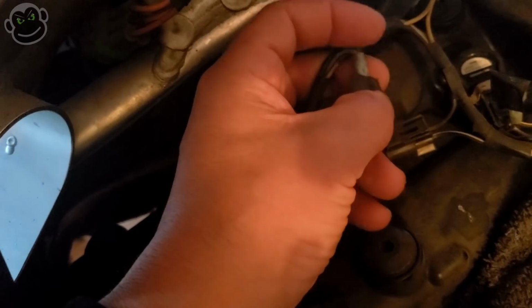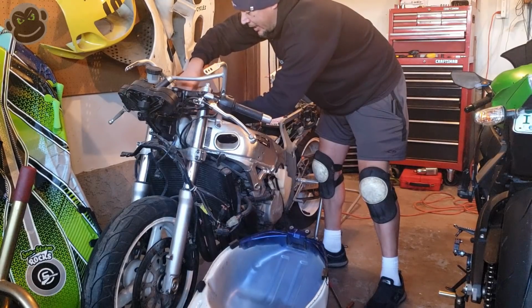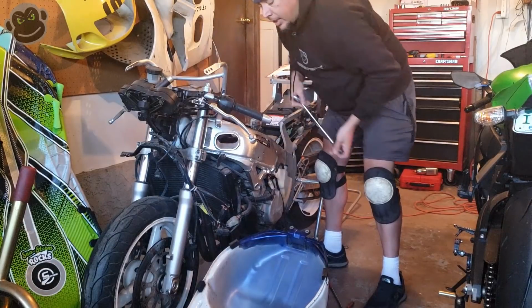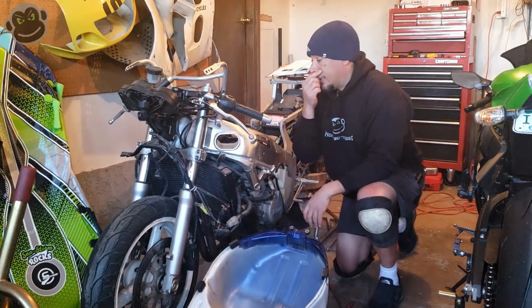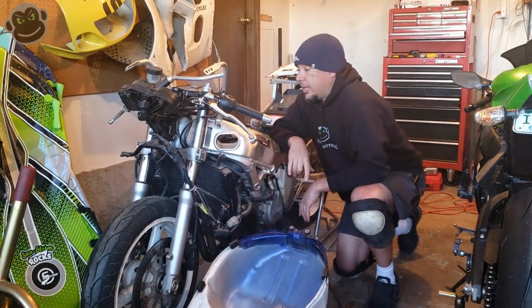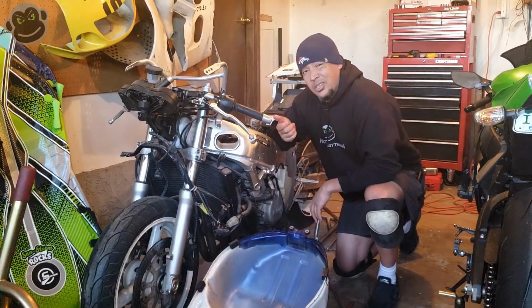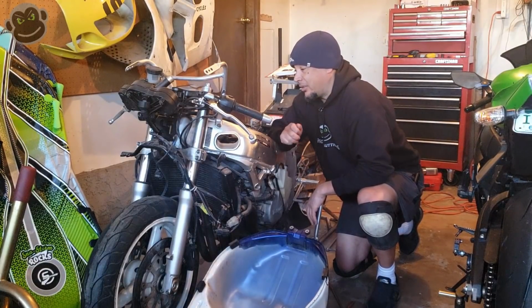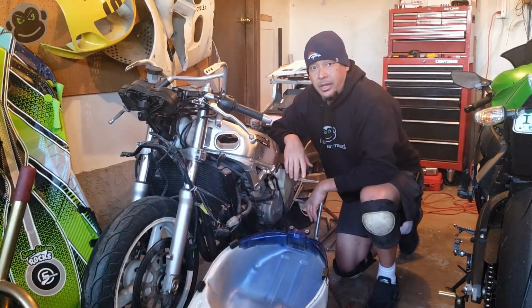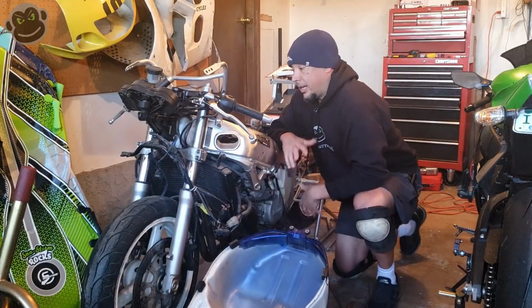So when I was actually racing, this is a 97 model, so back in the late 90s, I'm not sure when bikes started coming out with quick shifters, but back then you didn't have quick shifters on the bike, let alone programmable quick shifters. So I purchased a quick shifter kit, and it has a little sensor that wires up to the shifter, and then wires into your plugs and basically kills your spark as the shifter moves. And it's got a little mechanical knob on it, so you can tune how that works, the timing and everything, and the duration. But that's why those little connectors are there. That quick shifter actually plugged into those connectors. I have since taken it off because not only do I not ride this bike anymore, apparently I don't race it anymore.